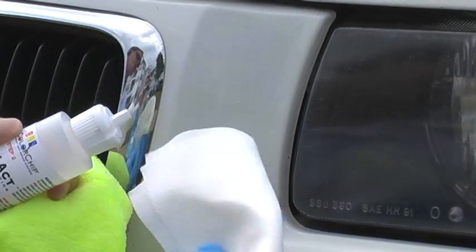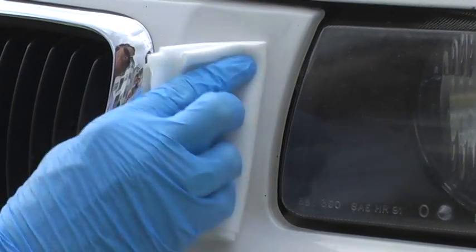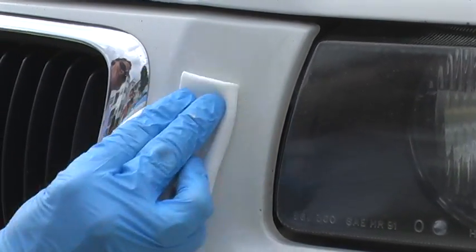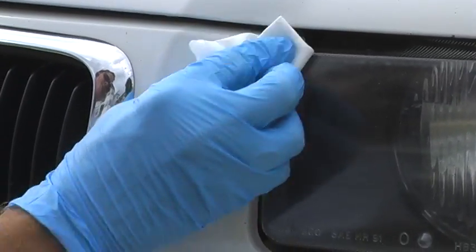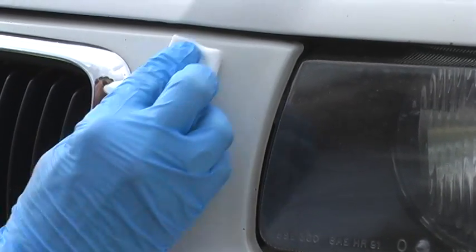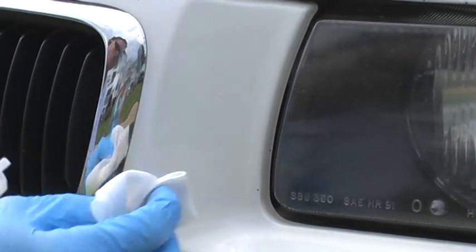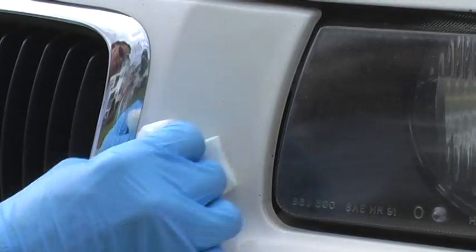Using the Seal Act on a folded cotton wiping cloth — you could use a white t-shirt also. I'm just going to lightly rub over all the paint I just smeared on the car. Using light pressure, not scrubbing or pushing really hard, just blending the excess paint off the car while the paint stays in all the little chips. You get a nice cleanly repaired chip without the paint blobs.